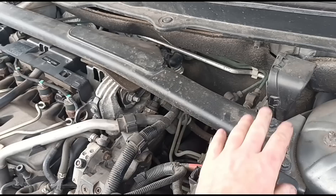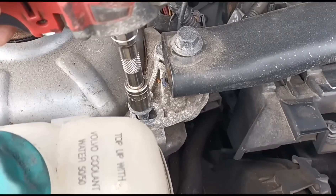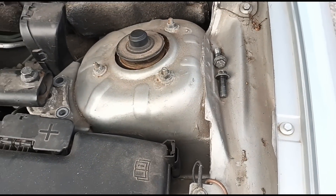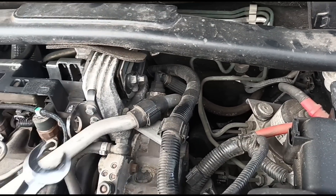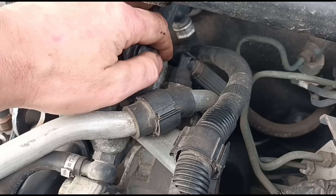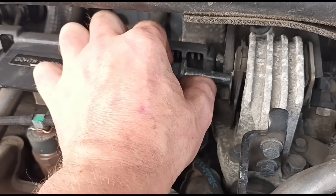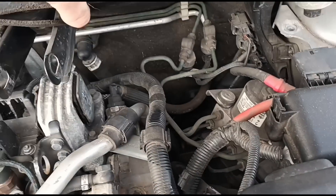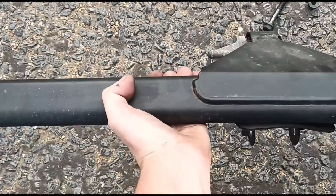We're going to take this arm off — the cross brace arm — and get down here to the DPF pressure sensor and have a look at what's going on and why it's not reading. On each side here you've got a couple of 13mm bolts, and two on the opposite side. In here we've also got a 19mm bolt. It'd be better if you could let the engine cool down as this is hot. Pull this bolt out from the side and this should now just lift up — get it from the middle, lift her out. It's quite a heavy piece of metal.